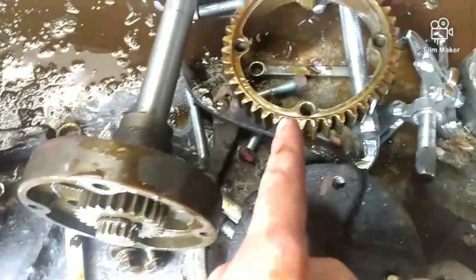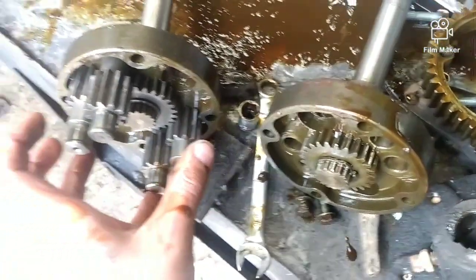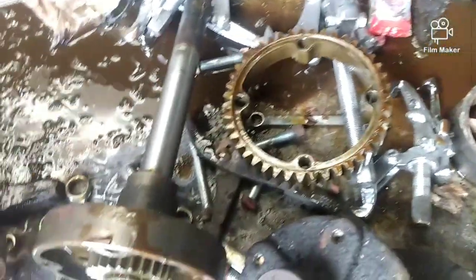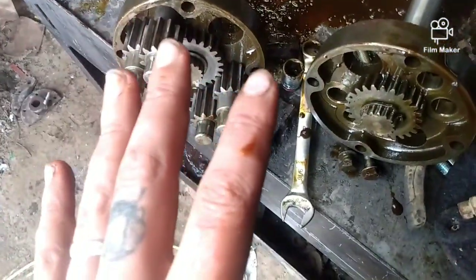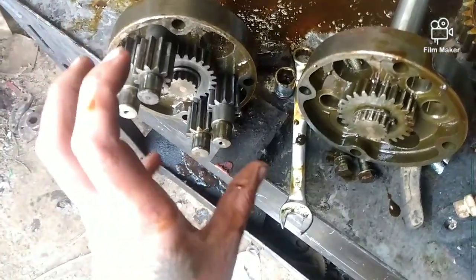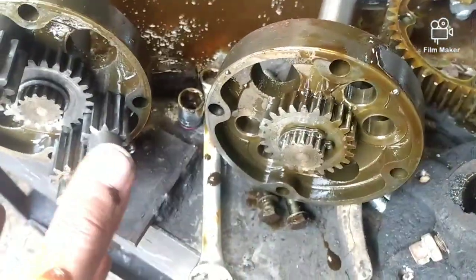The plan is: set your bolt gear off like we've done already, put this guy back on here without the bolt gear, bolt it, tack it right here. Once you've got that tacked, take this off, lay the weld to these gears — lay it on there pretty good. Pull the gear back on, axle back on. You don't have to do the welding fast, but you have to kind of do this process fast, because when you weld, the heat draws and it gets super tight, and it'll twist a little bit and draw, making it a big pain to fit back on.